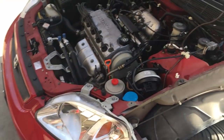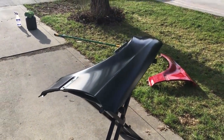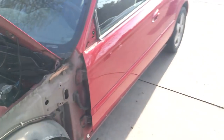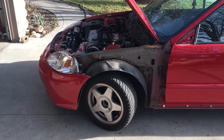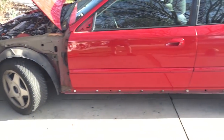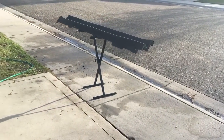It's going to be the whole process of me painting everything, rattle canning it for the most part, but I'm going to do a good job. I started the prep work on the mirror — you can see right here I've sanded down the whole mirror getting it ready for paint. I'm going to be scuffing the fender up and getting it ready for primer. I'm going to be using 2k — pretty much everything: 2k primer, base coat, and then 2k clear coat — so I'll be able to polish it down the road. I also got adhesion promoter for all the plastic pieces like the side skirts.